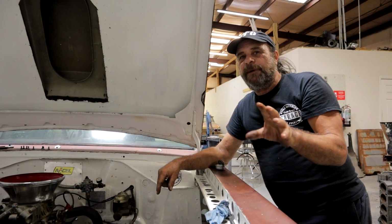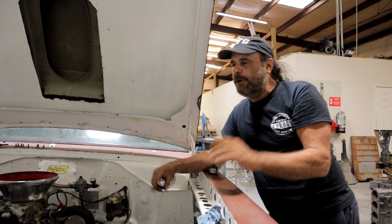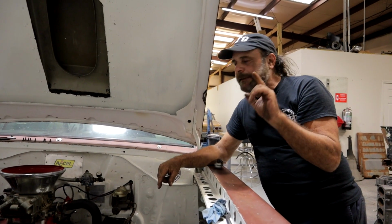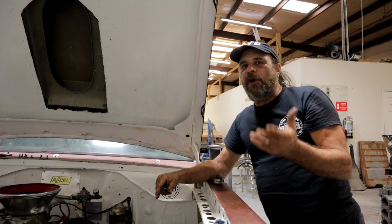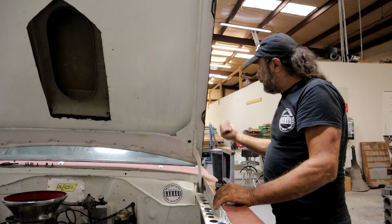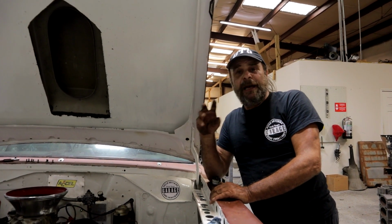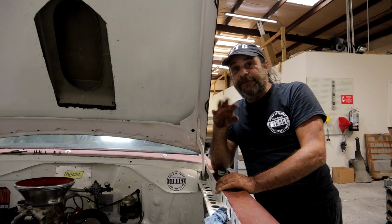It's funny, we talk about cars and what kind of car should you work with, what shouldn't you work with, what's difficult. I went to the auto parts store this morning to get the wheel cylinder, and you say, well, it's a 52-year-old car. What are the chances of a regular auto parts store having a wheel cylinder in stock for it? Well, the rears actually fit certain cars like Mazdas and whatnot into the 2000s. Ford Rangers, lots of cars use that same wheel cylinder. And the same thing with the front. The front has many different applications.